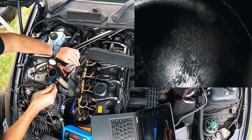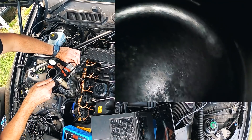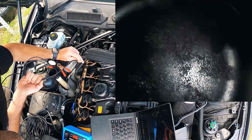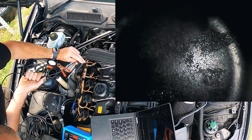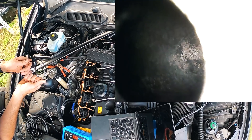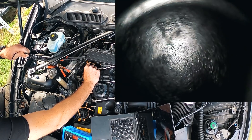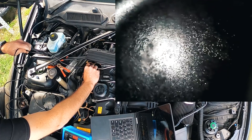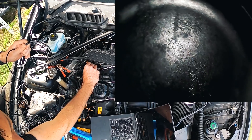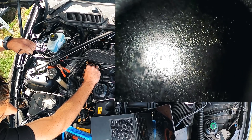Through the spark plug hole. I've got the brightness on the camera set at full brightness, but unfortunately with the sunlight on this laptop screen I can't see it very well. The piston looks very, very black — there's a lot of carbon buildup on that piston by the looks of things. Can we see any cracks in it? If it was cracked, there'd be no compression at all. But it doesn't look like it's running lean — lean it would be nice and clean. It's not a lean issue; there's just a tonne of carbon buildup.